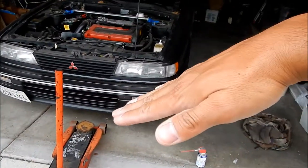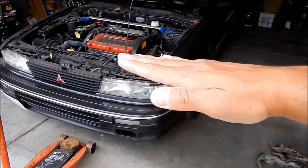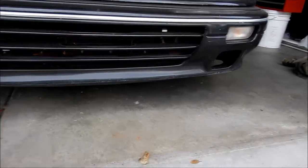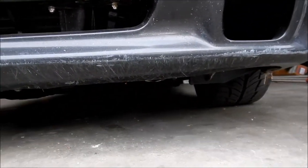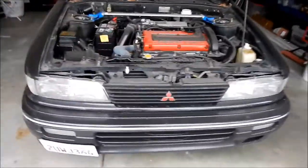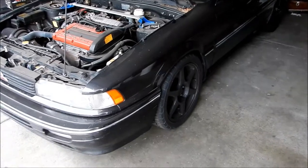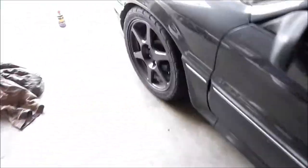The arm is angled up like this, and I can tell the boot is rubbing on itself because of the extreme angle. Unless you get some bump steer spacers or something — there are spacers that can make the arms go down like they're supposed to, so they have correct suspension geometry. Also, something is hitting when I'm driving. I want to raise it two inches in the rear partly because with people in the back it rubs like crazy, and raising the rear will also give me a little more oversteer with the car raked forward.